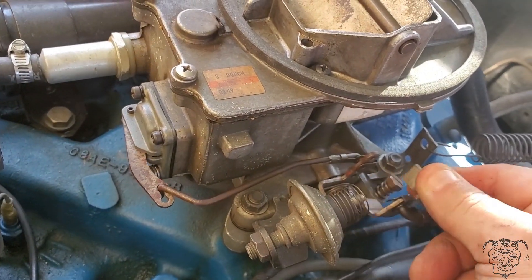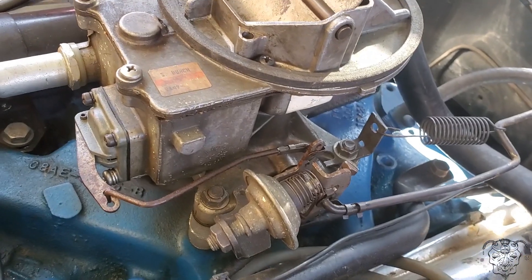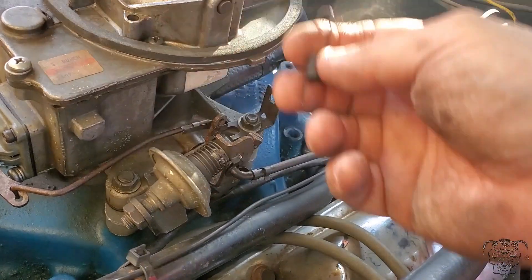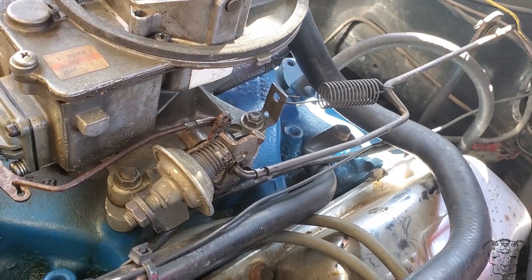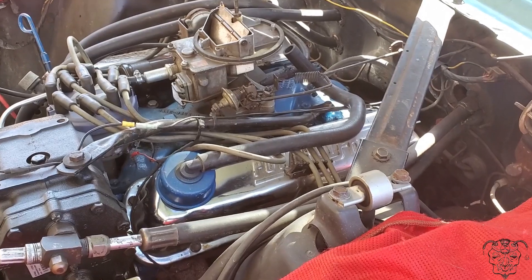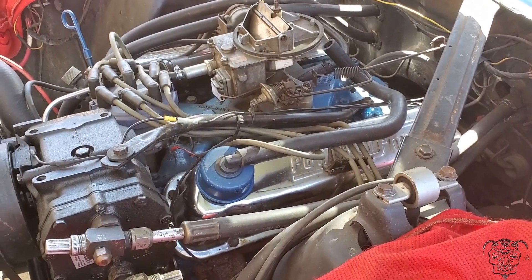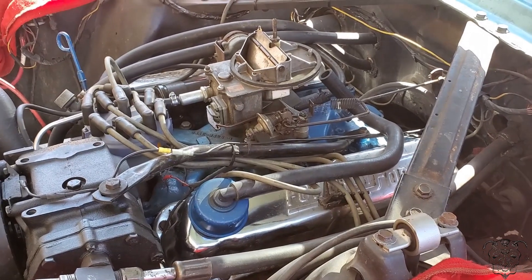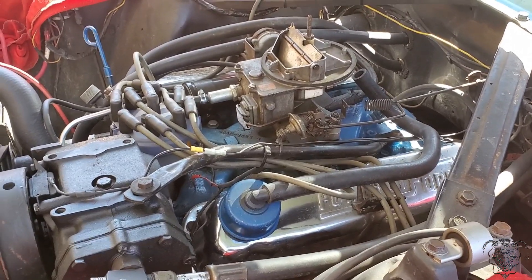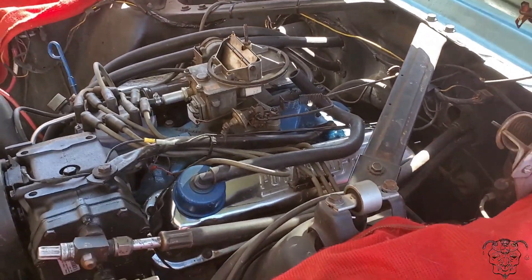Watch the accelerator pump — see it move? Yeah, before it wasn't because someone had a spring installed incorrectly from here to here and it wouldn't work. That would have been a future hesitation issue. But he went to get plugs — we're going to put plugs in and I'm going to try to adjust it, just the fuel flow rate screws on the bottom. If it fixes it, great. But if not, more than likely the float level is way, way too high, or the power valve in the bottom of the carburetor. So we'll get the plugs in and see what happens.